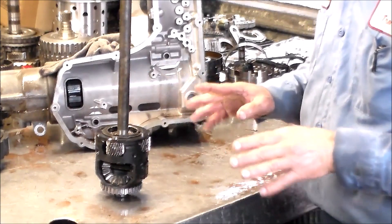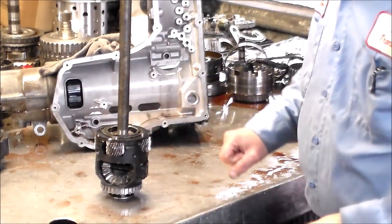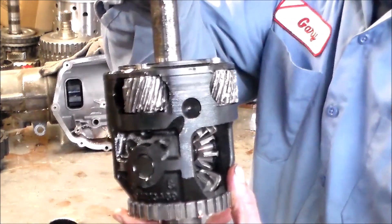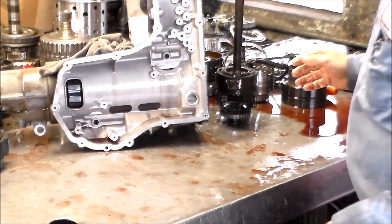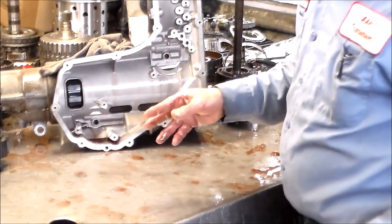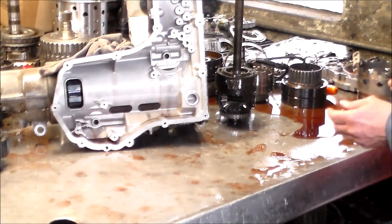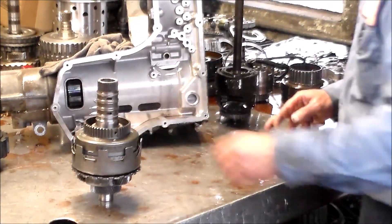The ring gear is split, so that's really not moving. That's obviously what broke the case when these gears broke up — it must have jammed it and split the case. There's just a bearing under here. Let me get organized here. I shouldn't have to change that. Let me get cleaned up here, get rid of some of the oil, and we'll take apart and look at the clutches and the drums — take this big section apart here. A couple of clutch drums in there.